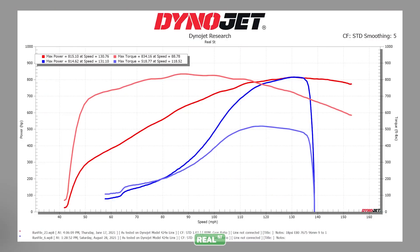When we overlay the dyno sheets from these two very different engine combinations, you can see they would have a very different feel at wide open throttle from a low RPM. The larger engine has a ton of torque under the curve — it would probably spin the tires immediately — whereas the smaller engine would be laggy and powerless until it came up in boost. You can compare mid-range and top-end power the same way.